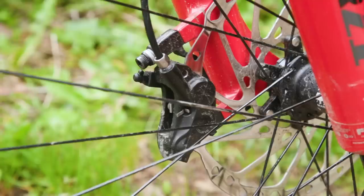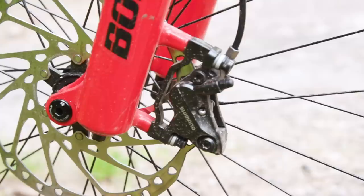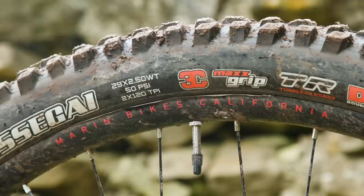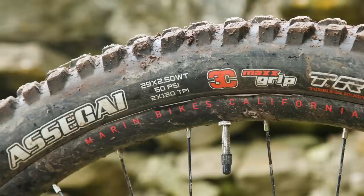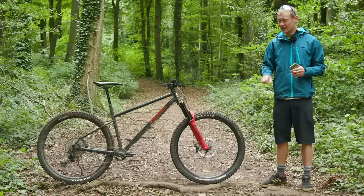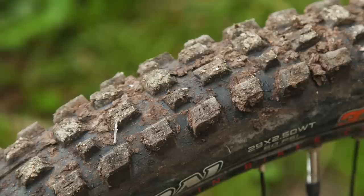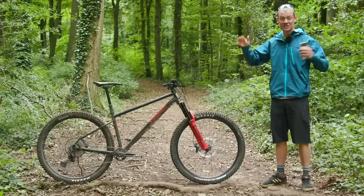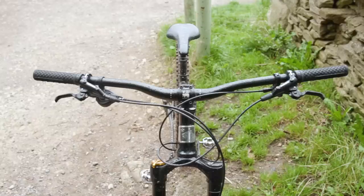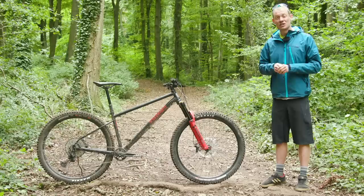The brakes are Shimano BR-M420s — essentially a Deore-level four-pot caliper brake. The wheels are based around Shimano hubs with a Marin-branded double-wall 29mm internal width alloy rim, fitted with Maxxis Assegai tyres — the tyres Greg Minnaar helped develop. These are in their triple compound max grip and double-down very thick carcass version, so they're weighty but very well suited to a bike designed to hit rocks, roots, jumps, and steep stuff. You also get an X-Fusion dropper post with a Marin saddle and Marin aluminium handlebars. The Elroy comes in at £2,295 here in the UK.